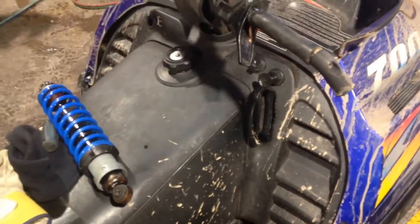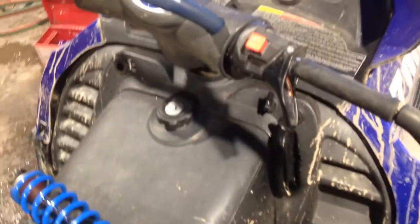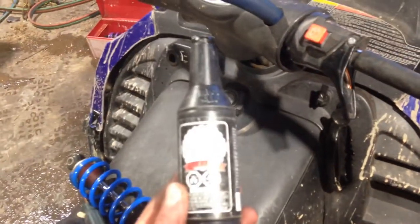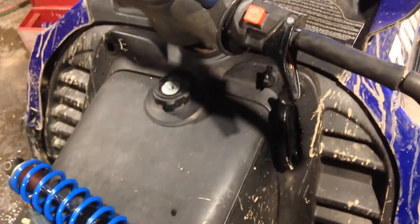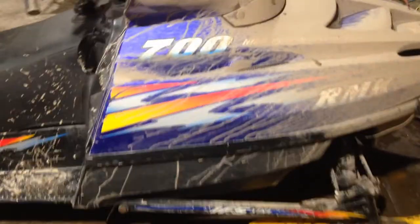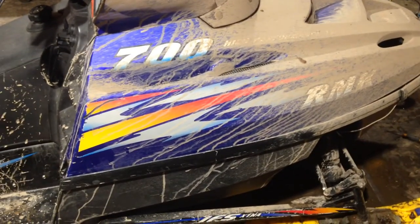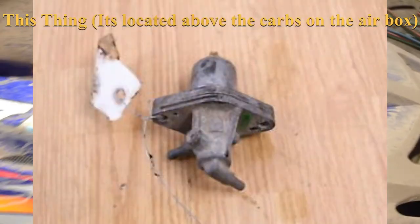If you have a leak, might as well fix it if you want a bit more power. If you're doing lots of mountain riding and going through powder when it's cold and your throttle starts sticking because your carburetors start freezing up, just use gasoline antifreeze — Clean Flow gasoline antifreeze. One bottle per tank and you'll be good to go; it won't seize up on you. These motors are great — no crank problems, no piston problems, the reeds are all good. The carburetors are a little fussy but if you clean them up and get proper jetting they work fine. People talk about the ACCS system going bad and running too rich; there's a way to delete that which you can find in the forums. Overall these are good machines — they're way heavier than newer ones, but who cares, have fun.